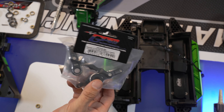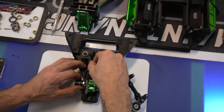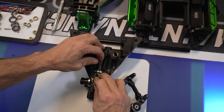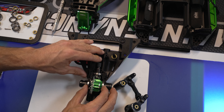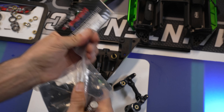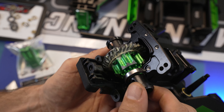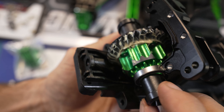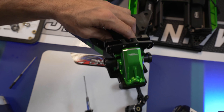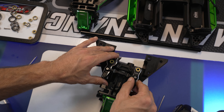Let's check the front gear mesh - set this bearing in there and see what we got live on video. Brand new chassis, and look at that - there is absolutely no play. No play side to side - that's the GPM Mod 1.6. On top of the GPM diff cases, we're going to take the GPM upper aluminum bulkhead, add a little Udder Butter. Check and make sure everything is spinning nice and free - oh yeah, nice and free. Time to drop the steering rack - GPM 7075 aluminum with the Avid bearings - super nice fit.